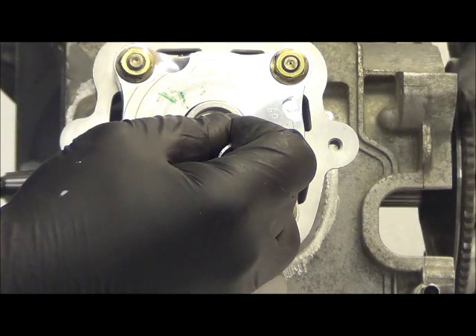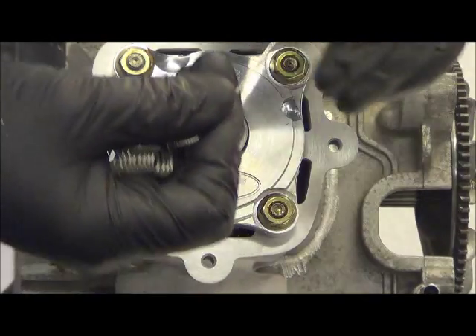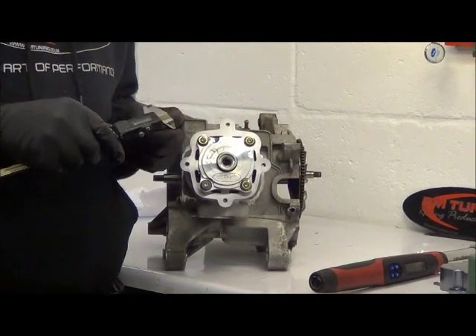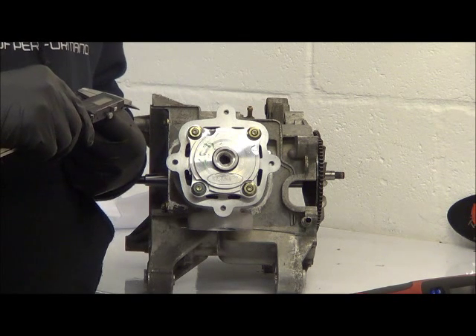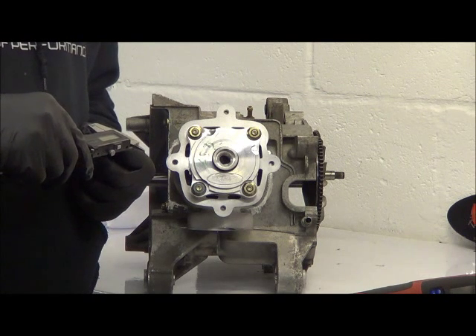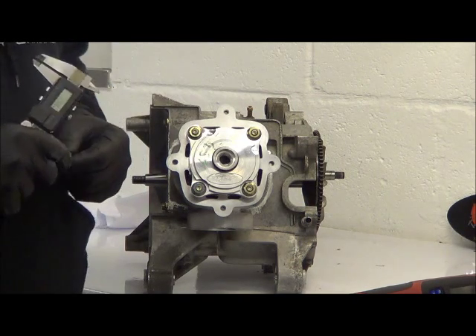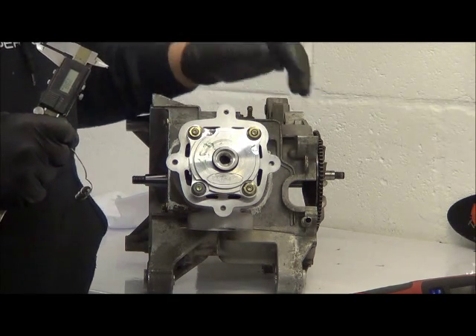The other way is to allow for this and do it from one side with a ninety degree piece of solder. Pop that in there, make sure you're up against the cylinder wall, and rotate up to top dead centre. Feel it come up and flatten the solder. We then take that solder and read it with a vernier gauge. You need that to be anywhere between 0.9 and 1.2mm — aim for one millimetre as ideal. If you're outside those tolerances you'll need to use the base gaskets provided in the kit to achieve that result.